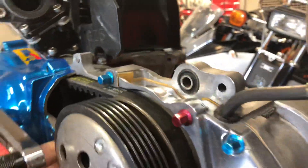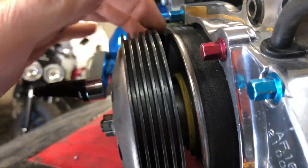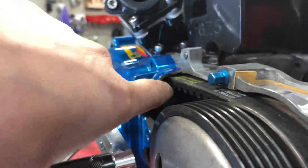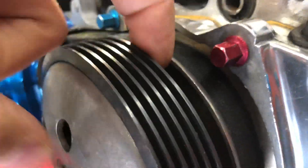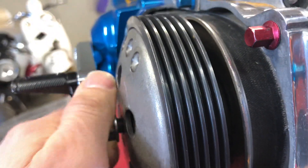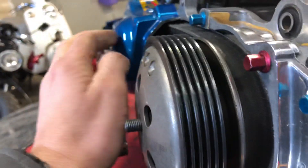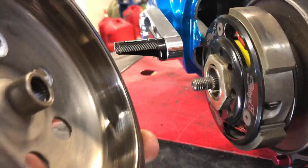I can see right here — and we run into this now and then — certain bells don't work well with the ZX pulley. What's going on here, and this is just a good example to keep an eye on things when you're having transmission issues: his belt won't go high up enough in the front, won't sink down far enough in the back, so he's not getting the top speed that he should be. What's going on is there's not enough travel here — this pulley is hitting this bell. We need one of two things. Likely with this setup, we'll either turn this bell down and machine it to give him a little bit more clearance so that pulley can travel out further.